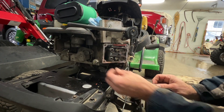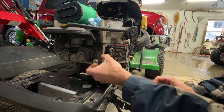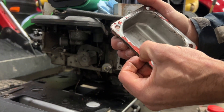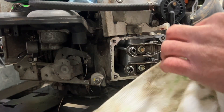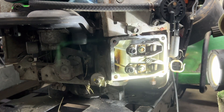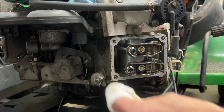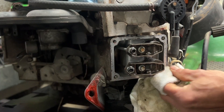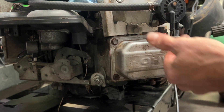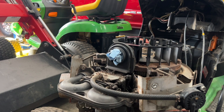Now you've got to clean your silicone - I usually do a razor blade here. You can use your fingernail or anything you want. I'll clean these valve covers off here, just run my rag in and soak up a little bit of oil in the bottom. Double check everything, make sure there's no debris in there. I'll put a little bit of carb cleaner on my rag and run it all the way - just a degreaser. Put my hose back on the fuel pump here, give this a good cleaning.